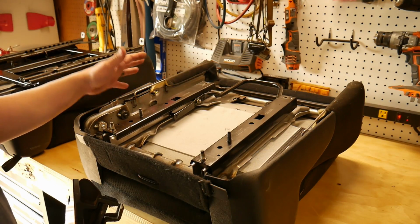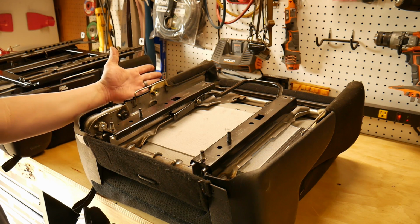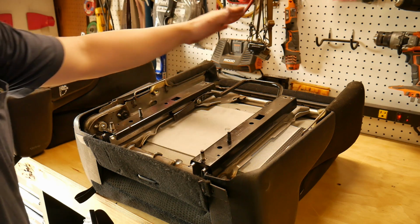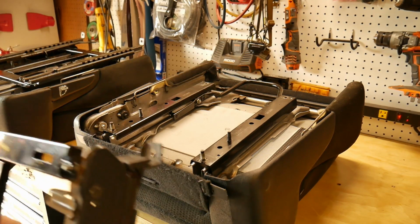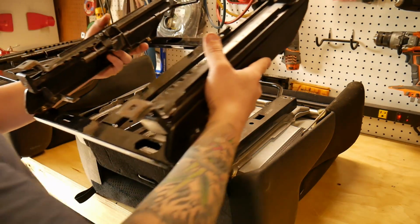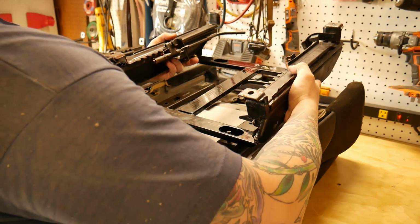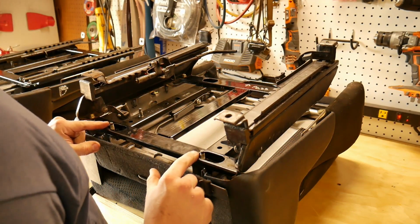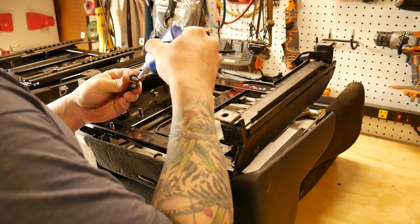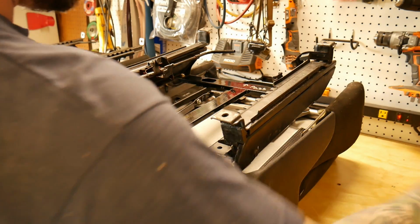And now the passenger seat, have your tilt adjustment on your left hand side with the front slider facing farthest away from you forward. Take your slider with the factory sliders facing up. You'll place them on the farthest back stud. Put your Loctite and your washers.